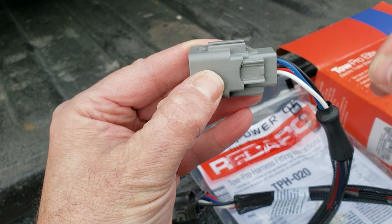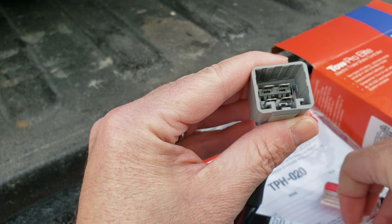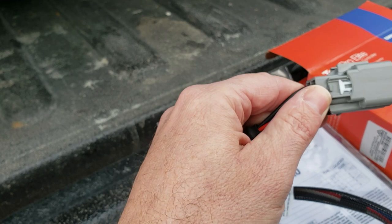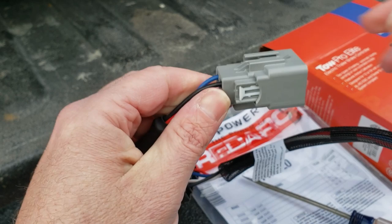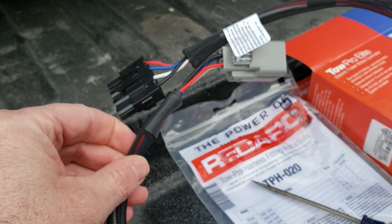That's pretty much all there is to it. You swap the blue and the black wire out, change the positions on those, put them back in, and then take your little retainer and stick it back in there. Push it all the way in until it locks into place — the white part will be all the way back. If you've got a little pick or a little screwdriver, it does not take long at all. That will allow you to use the Ram harness to plug this into your Jeep Gladiator. This harness is about 20 bucks. Hopefully that'll help somebody out and just makes things a whole lot easier because there's no cutting, splicing, or any of that.